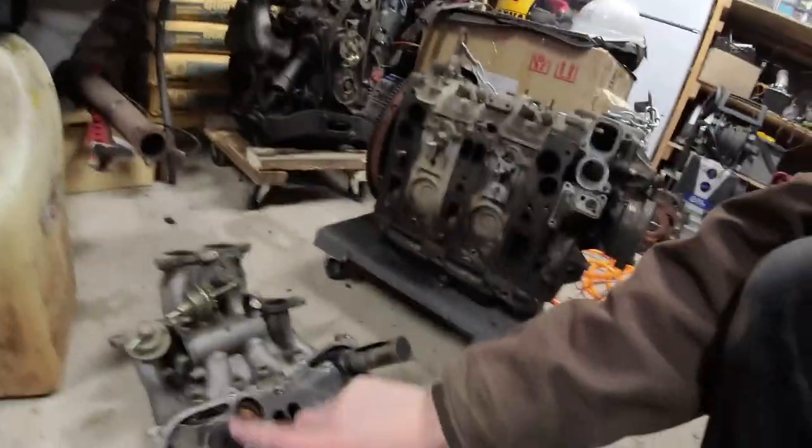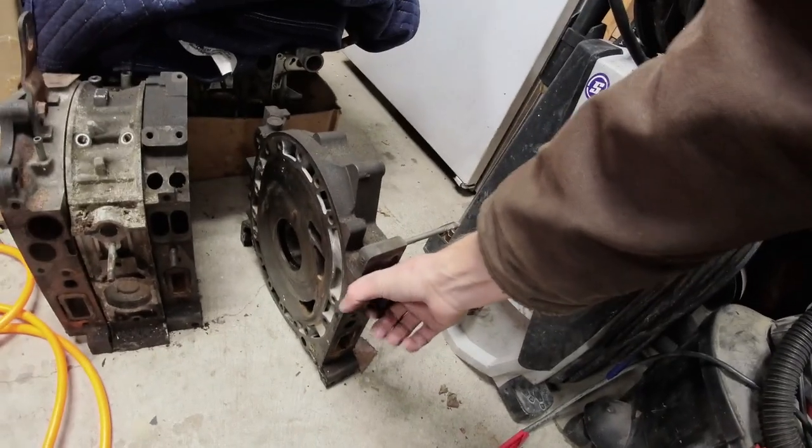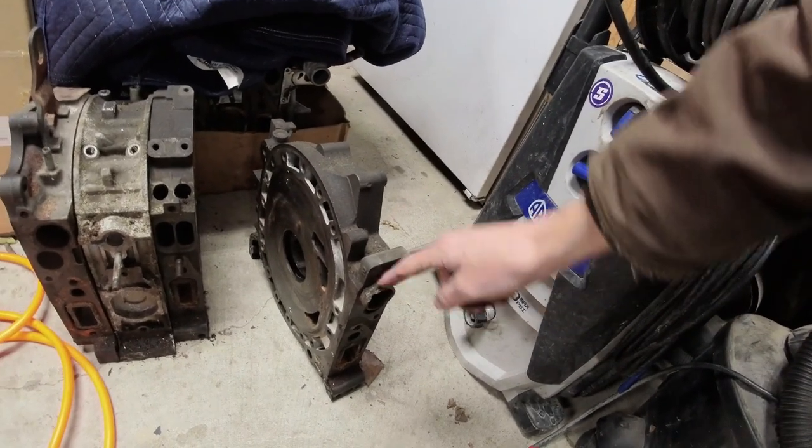So these sleeves slide into the front and rear iron up here. And you can see on this end, which is out of Calvin's RX-8, this six-port sleeve is physically stuck in the front iron. It's closed. We can't get it out. That front iron is probably junk because of that. You don't want to be that guy because you definitely don't have horsepower even if your engine runs.